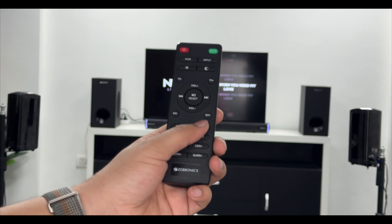In terms of the audio experience, this soundbar supports Dolby Atmos, which is a good feature. However, Dolby Atmos only works when connected via HDMI ARC — if you are using Aux or another input, Dolby content will not play in Atmos mode. When connected through HDMI ARC from your TV or set-top box, you get the full Dolby experience. Multiple sound modes are available — music, movie, news, and sports.